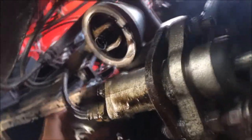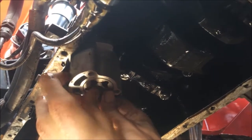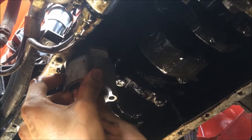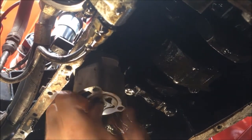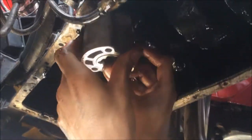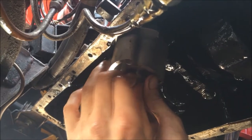First things first, locate the pump. Now we know that's located. It's nicely in the shaft. You just turn it round and round on its spline, and there you know it's located, right? There's no gaskets on these, they're just a straight fit from the old body up to the engine. And just turn it. You see, it's not in, it's not in, it's in.